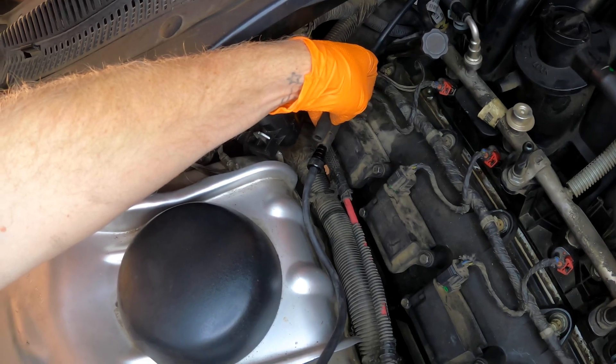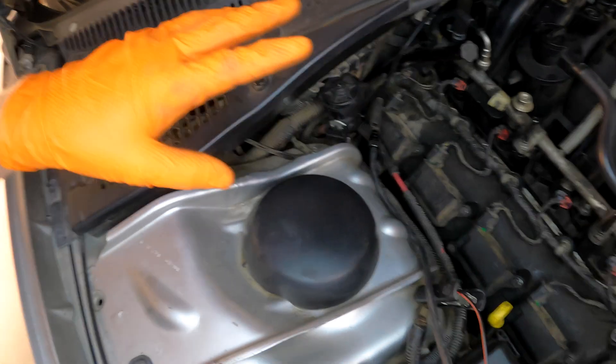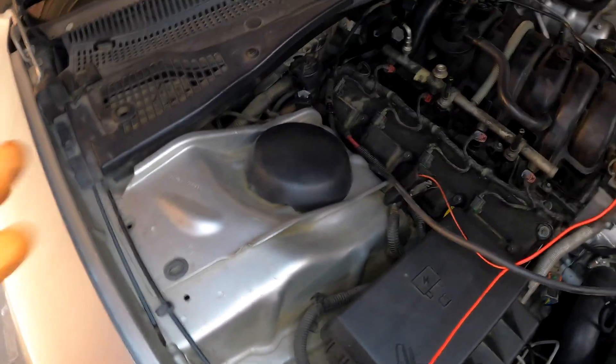I plugged off the fuel cap using a bag — I put a bag under the fuel cap and then put the fuel cap back on. And you would think that would be good enough to do a smoke diagnosis.